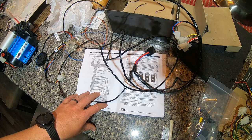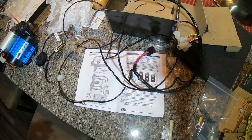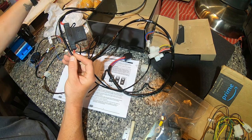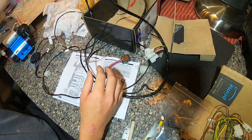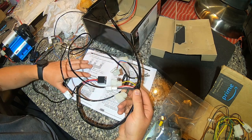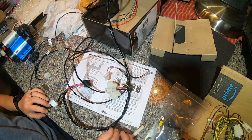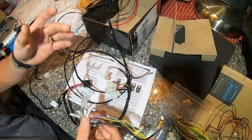It's all laid out here but can be confusing if you don't know what it all means, so we're going to go over that. This is all leftover from the first project, so we're going to show you what we've got to do. First things first, you've got your main two wires — positive and negative coming in — and on the negative you've also got a second negative wire that connects straight to the battery. That's your incoming power to this main block. We're going to cut back all this electrical tape from here all the way back to the relay and all the other wires, so we can get in and remove what we don't need, such as switch one and two since we're not using an air locker.